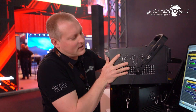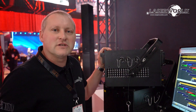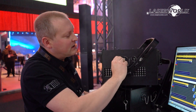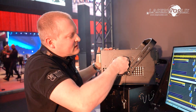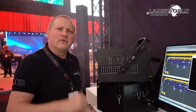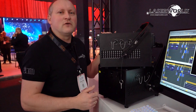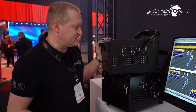I'll pull up this smaller housing to show you — at the side you have the option to do color convergence calibration. If there's any misalignment of red, green, and blue, you can easily access it from the outside. You just open these little side openings and adjust red, green, and blue color convergence matching. You normally don't have to do that much because the unit is built very durable and tough, but you have the option if you've had a rough ride in your truck or if you drop the device.